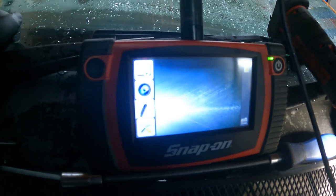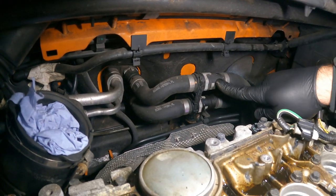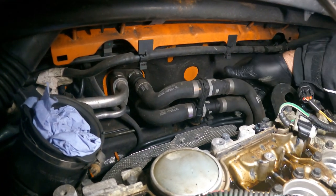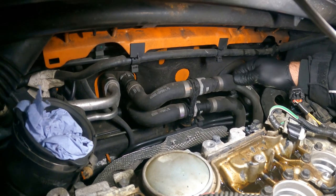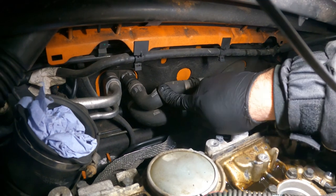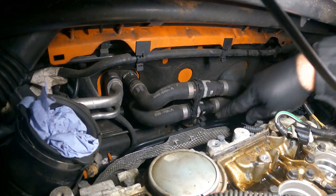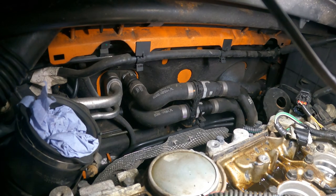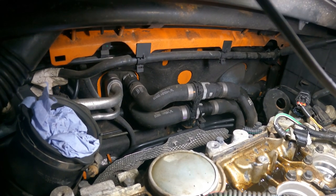If you look here, that pipe is new compared to that pipe — it's clean. These are very common, guys. If you've got one of these, make sure you keep your eyes on these heater matrix pipes — it pops up on the groups all the time. We've had it go before at the Nurburgring. So that's obviously been replaced. The likely scenario: popped a pipe off, lost the coolant, got too hot, and cooked the head gasket. Pretty much what's probably happened here.